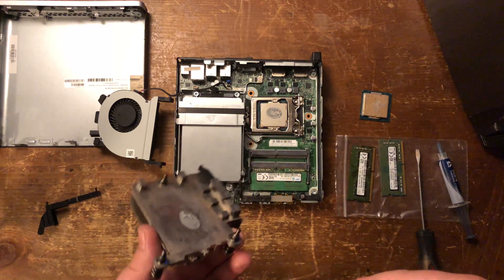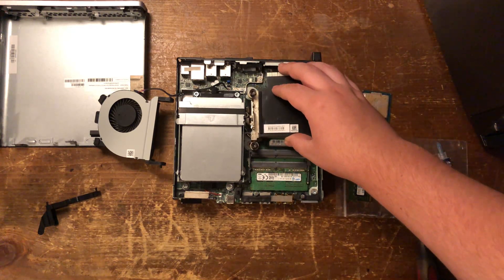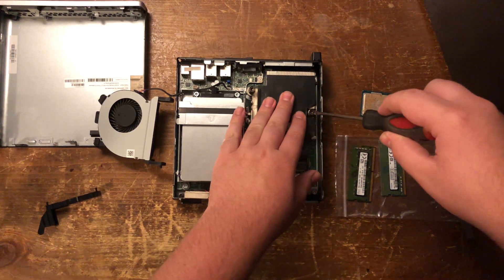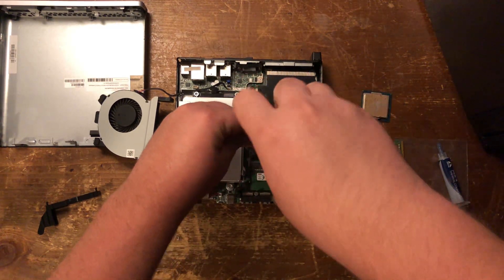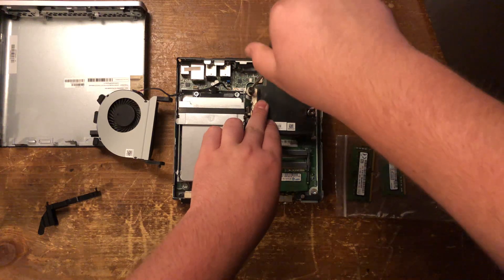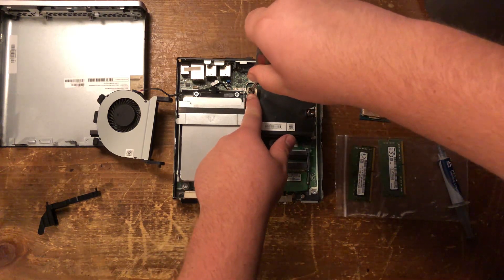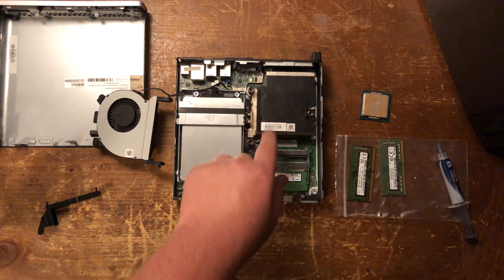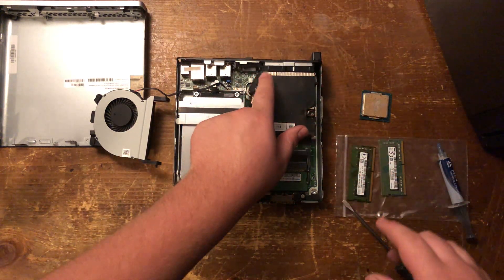You've got your cooler cleaned — I took it off after I forgot to record that part. You're going to slowly put it on there, and preferably turn one screw a little bit first, then screw the next screw a little bit. You just want to make sure all the screws catch the threads, and they'll get to a point where they bottom out. At that point you stop screwing — the cooler is installed. Then put your little plastic piece back on, which is probably a heat guide.